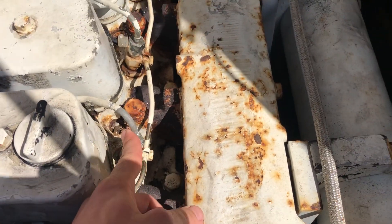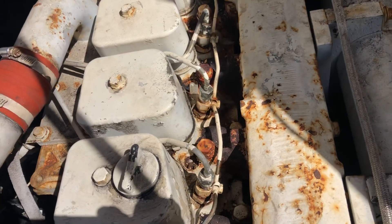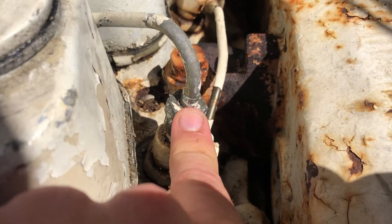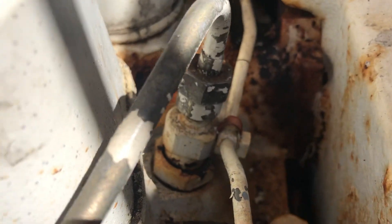There are six injector hoses, and you'll give them about a quarter turn, maybe a half turn. You'll want to turn the engine over and you'll see fuel start to spill from the head of each one of these injectors.